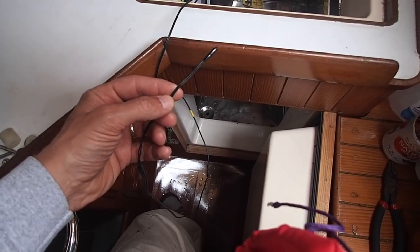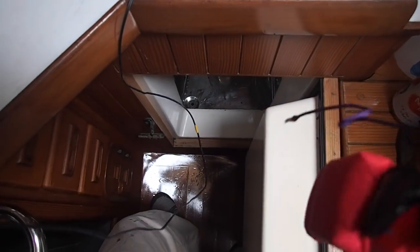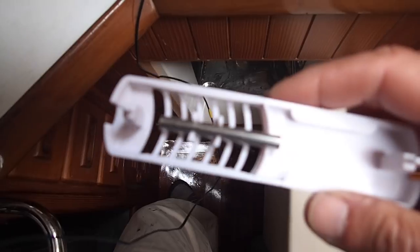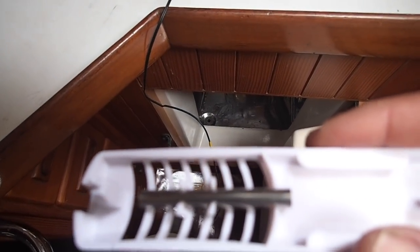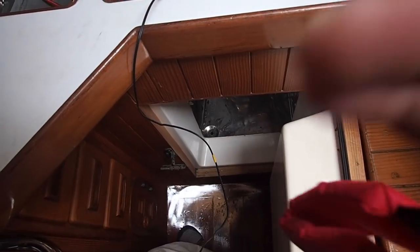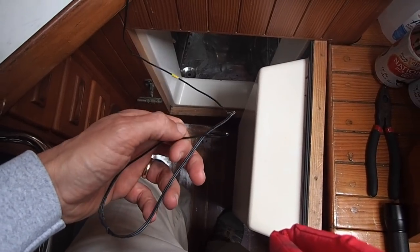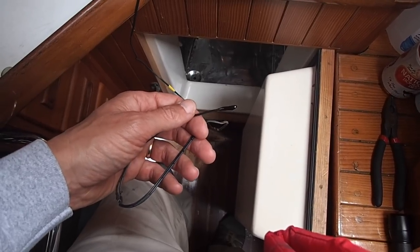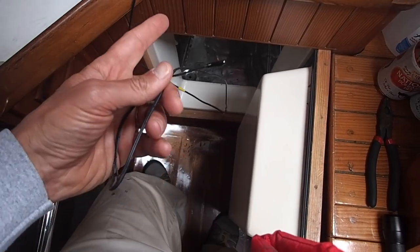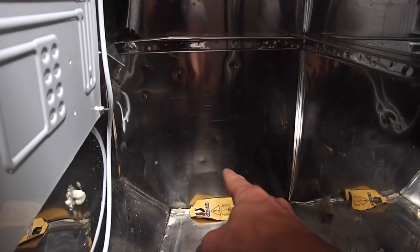This is our temperature sensor for the smart control. The instructions indicate that you should bring this temperature sensor outside the box and then back in if you're installing the potentiometer — the control unit — inside the cabinet. We're going to attach it right in here, which is our temperature sensor grill. We're going to have to drill another hole through the back of the box and attach it in here. Inside the fridge, you want to have at least 20 to 27 inches of this cord wrapped in there so the warm temperature from outside doesn't affect the temperature reading. I've taped off 24 inches and I'm going to run it out through our hole, then install it 2 inches from the bottom.